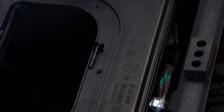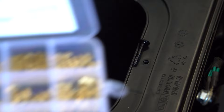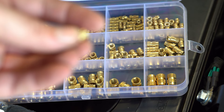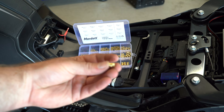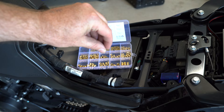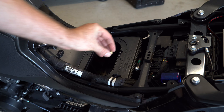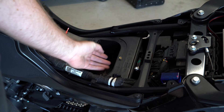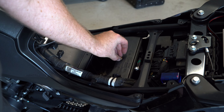I'll show you what I've got. These are actually threaded heat inserts. What they are is a little insert which you actually melt into the plastic. What I'm going to have to do is drill out a hole just big enough to fit these in - try not to drop it into the airbox - then use a soldering iron to melt it down into there. I'll get some tools ready and we'll see what we can do.